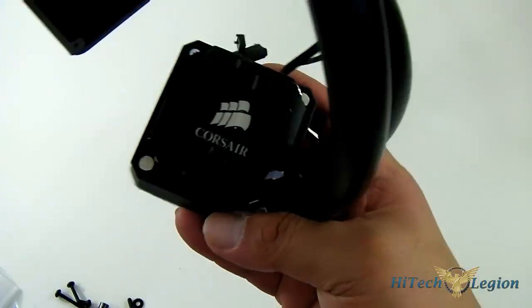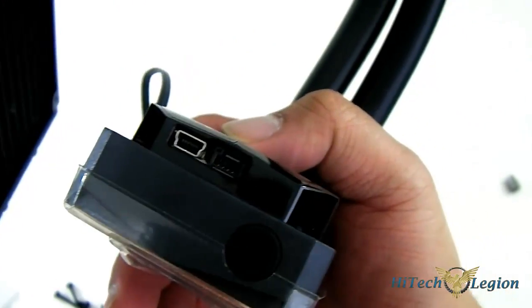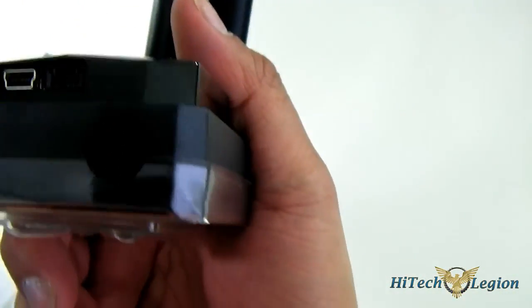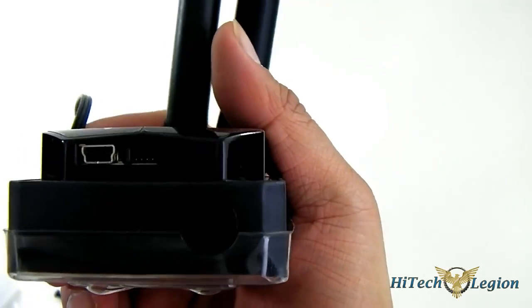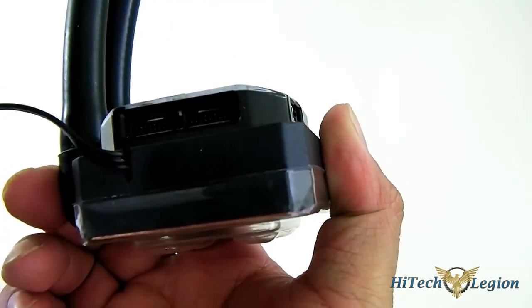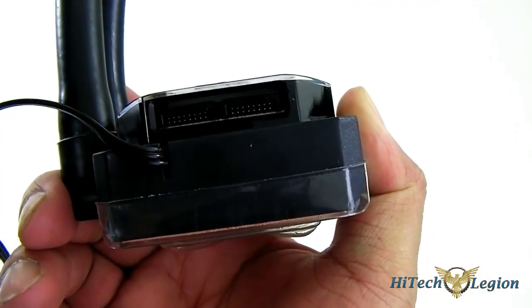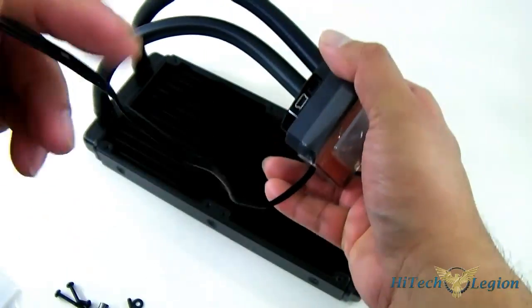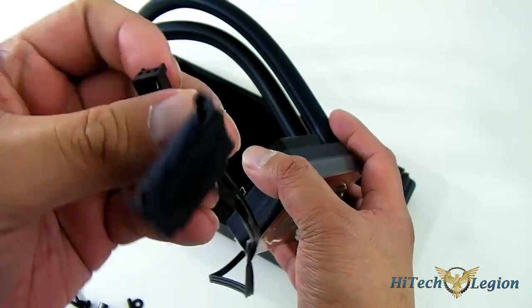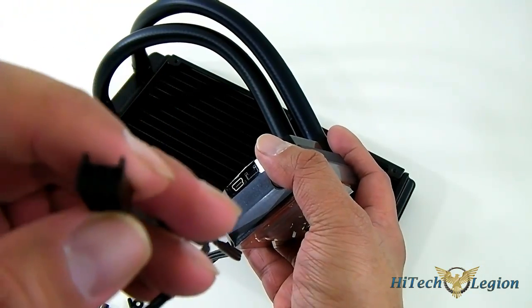On the pump unit you can see the Corsair logo. The H100 logo lit up and this one probably does as well. You have the Corsair Link connector there, the older Corsair Link connector to the right of it, and a standard USB connector for the USB cable attachment. There are also two new connectors at the top — not the same as the standard 4-pin connectors on the H100. There are also hardwired cables: a SATA power connector and a dummy plug for attaching to your motherboard fan header so it doesn't register as having no fans installed.